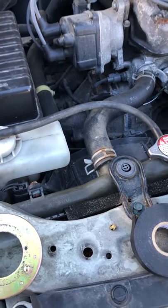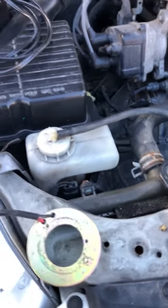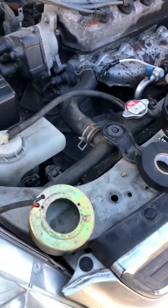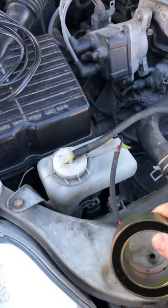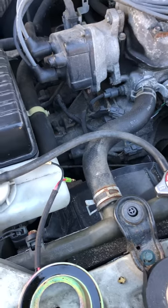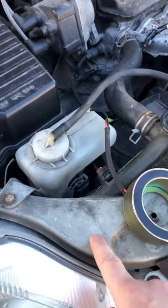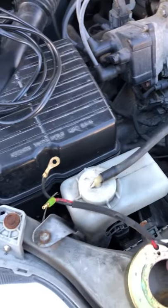So I wanted to figure out what was going on, and this is just another way to bench test your coil. This guy here just fits over the top of it. What I did — this is a magnetic surface here, these spacers are grounded, and all this is is just a giant magnet, so if you stick it on there it can easily pull off.